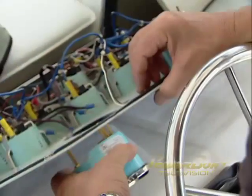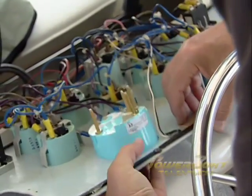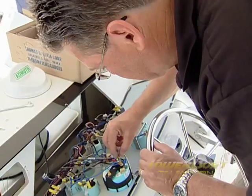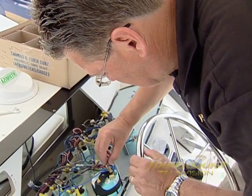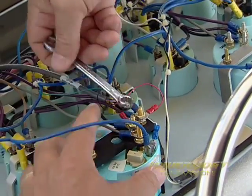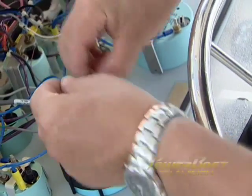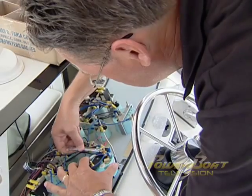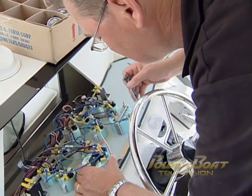Next, pop out the old instruments and slide in the new. Depending on the style of the new back clamp, it may have to be installed first. Next, secure the instruments with the supplied washers and nuts, remembering to hand-tighten only, then align the gauge. Finally, reconnect the wires to the appropriate ground, power, signal, and lighting connections as marked on the back of the gauge, and tighten the nut securely.